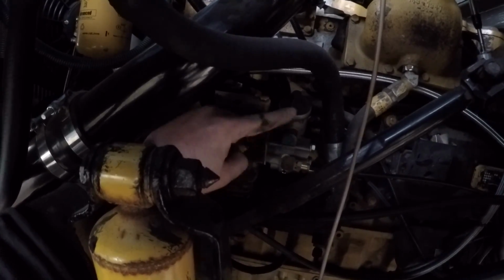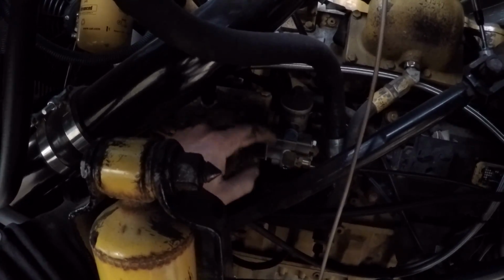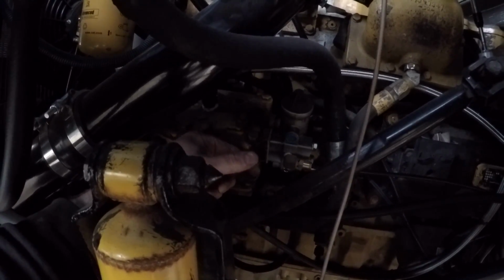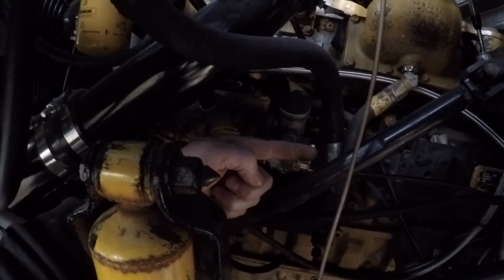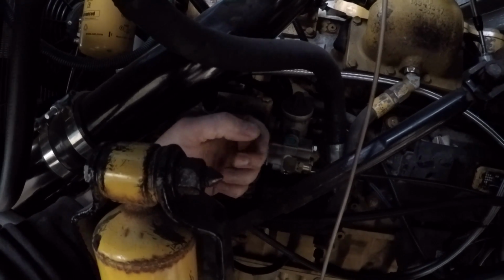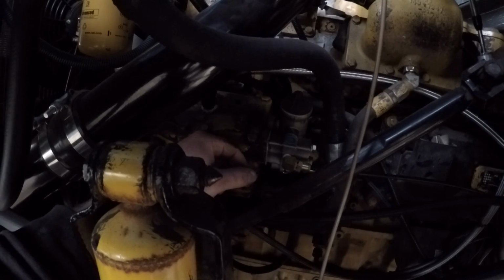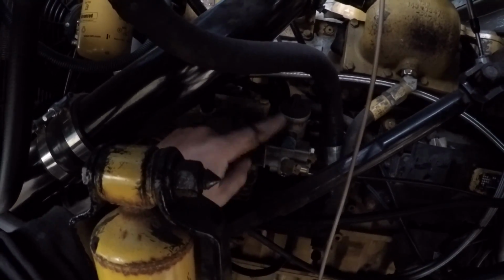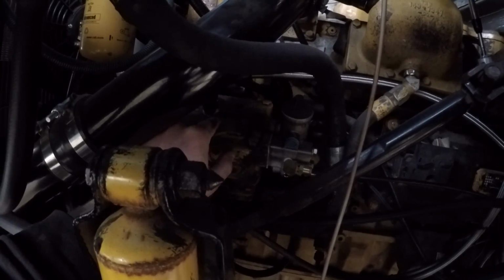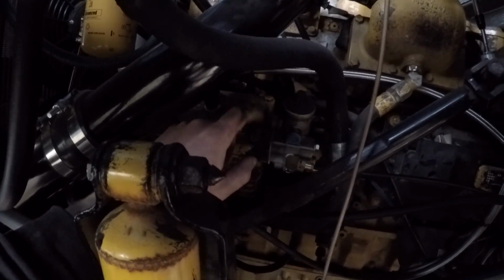So when your tank reaches pressure, the valve in here moves and opens your unloader valve, which means the compressor will still run, but it won't make any pressure. And it also sends that unloader air pressure back to the dryer, which opens that purge valve and makes it go psh, and that'll get all your moisture out. And it also relieves the pressure in the line between the two, so that way when it starts back up, it's not fighting all that pressure.